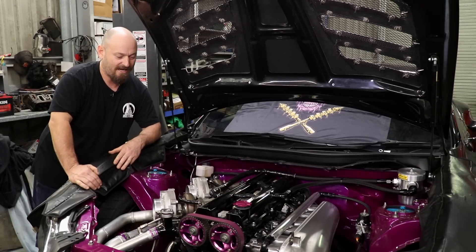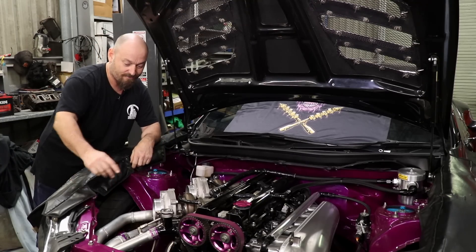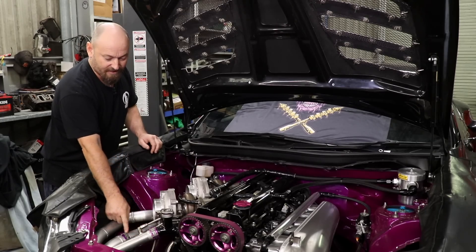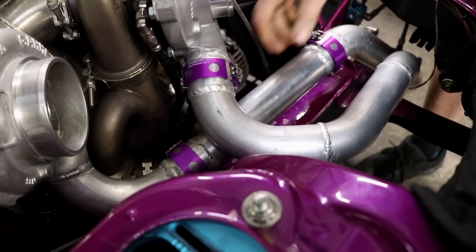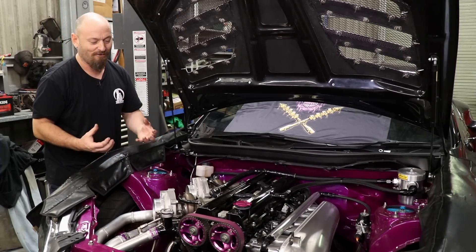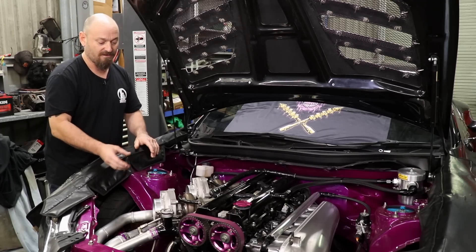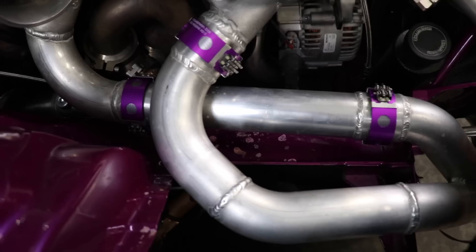Starting from scratch with an engine bay you have to plan everything and foresee what you've got to do. Obviously twin exhaust, twin inlets, twin intercooler pipes — the twin intercooler pipes then merge into one, so we've got multiple Wiggins clamps along there. We also needed a slip function to be able to get these pipes on and off, so there are two clamps on the back turbo's pipe and one on the front. That's to allow us to slip away that section and pull it out. When you move away from silicone hose joiners with flex, you have to really think about what you're doing, because you then can't fit things if there's no movement available after you've welded it all up.